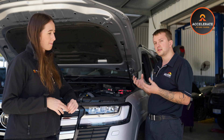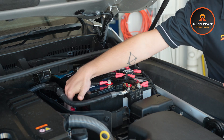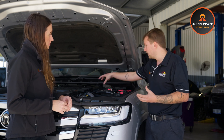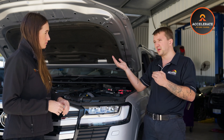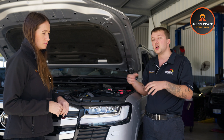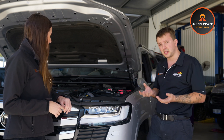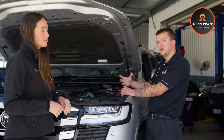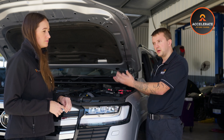The other thing that is part of the towing setup is the circuit breaker for the Redarc TowPro Elite if you opt for that as well. That's actually located down on the side of the tray. It's a 30 amp auto-reset circuit breaker. The reason we use an auto-reset circuit breaker on a TowPro is: in the event there is an issue with the brakes, that circuit breaker will tick off and then after a period of time it will re-engage again. So even if there is a short or a reason that circuit breaker is faulting, you don't lose all of your brakes — because when you're towing a three and a half tonne van, that's the last thing you want. Also on the side of the tray is our relay — a 100 amp relay that is triggered by the ignition circuit, which just switches the isolated Anderson plug on the rear via ignition. So there's only power down there when the car's running.